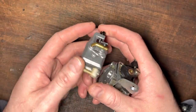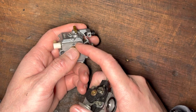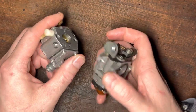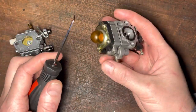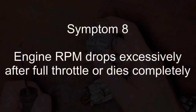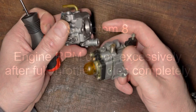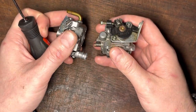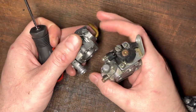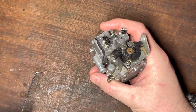That's generally two things: one, the needle inside the carburetor is not seating properly, most likely from dirt or debris inside; or two, your low-speed screw is set too rich and giving too much fuel, so you want to close it. You may also find when tuning engines that they seem okay, but when you come off wide-open throttle and bring them back to idle, they actually drop and stall.